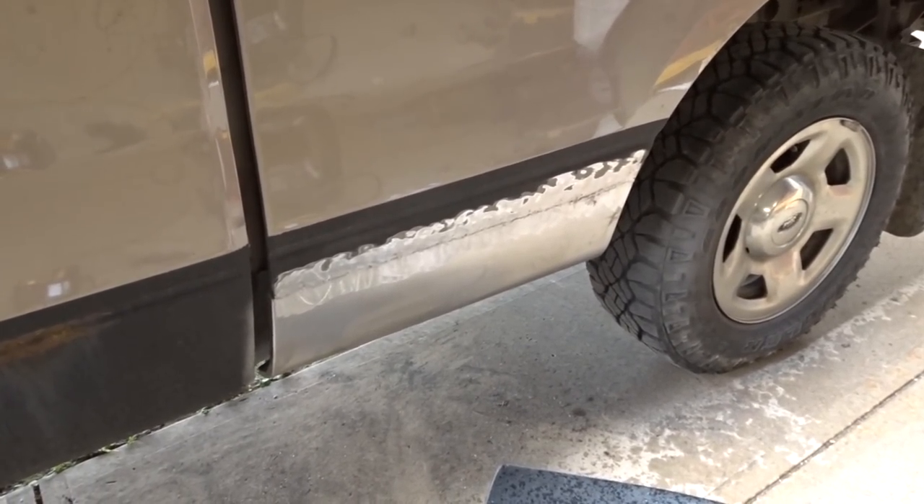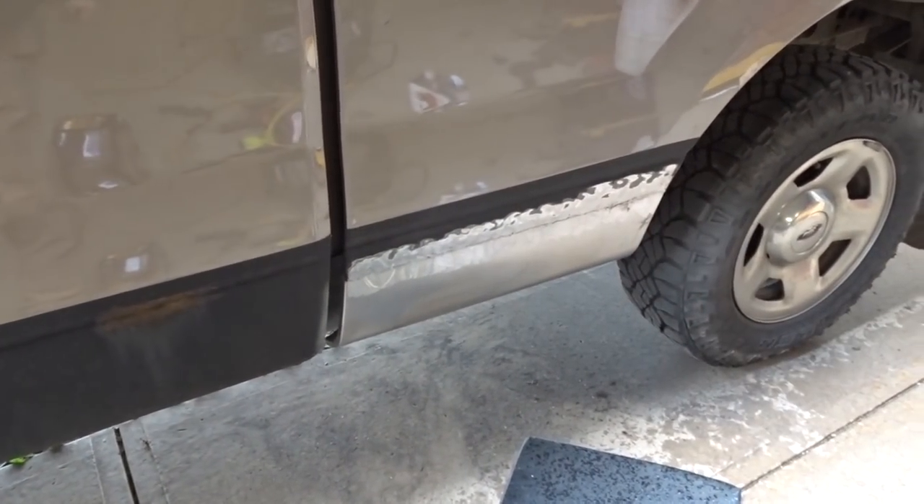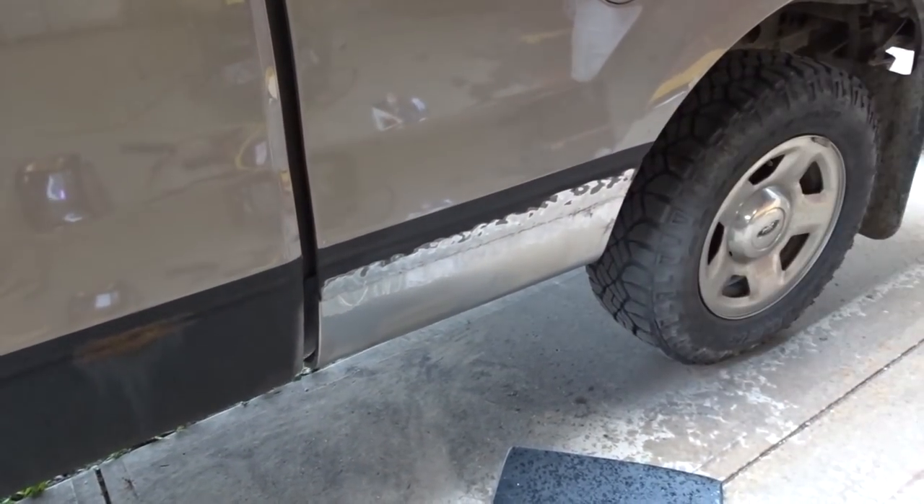I'm a little sad that the panel pulled down after welding. This side actually welded really good, but this side here kind of pulled in. I took my time, was patient, let the panel cool down beyond cool to touch — and the thing still pulled in the corner. Oh well, shit happens. Try to pound it out a little bit, but you know how that works. Let's get some Bondo on there to hide it.